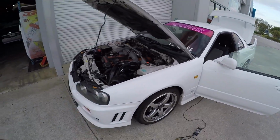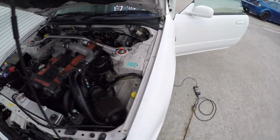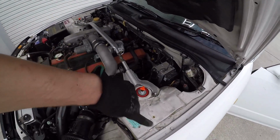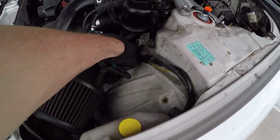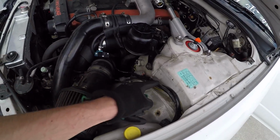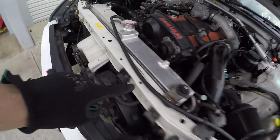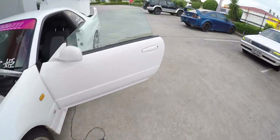Yep. Okay. All right, so I finished wiring in the trigger switch for the fans, and I'll show you what I did. The O2 sensor that used to be in there that I replaced with the wideband, one of those wires I can use as a trigger wire. And see this yellow wire here? I've got that put in there with a crimp terminal, all heat shielded and taped up. Then this wire comes along here, inside here, down to the trigger wire that goes to the two relays.